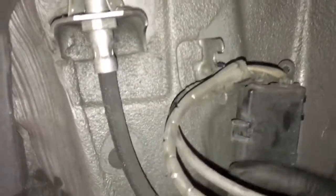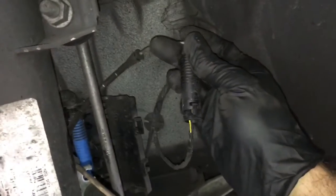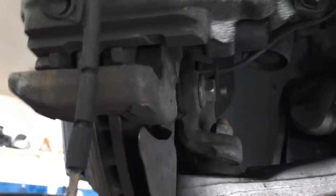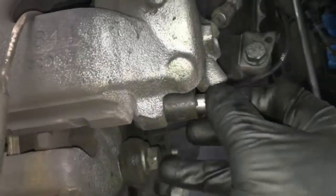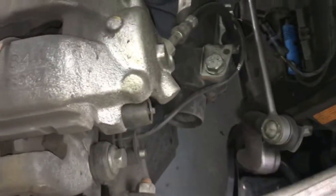You can open this little door by pulling the little tabs back and pull out the electrical connector and disconnect it. Now inside where we took the cap off, there is a 7mm Allen. We need to remove the two bolts that hold the caliper on, pull the pins completely out, and set them aside — we're going to lube these up later and reinstall them.